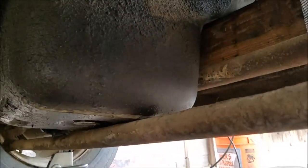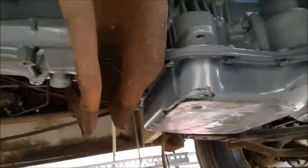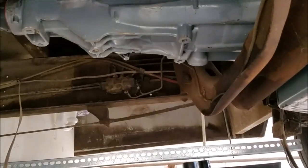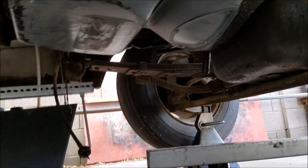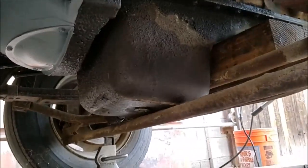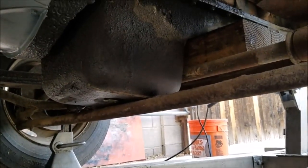I'm touching the steering linkage on the bottom of the oil pan, and my trans pan — the cross member is in the wrong spot, it needs to move back six inches. Because I'd like to move the engine back at least another two or three, just so the oil pan can be fully exposed right there.